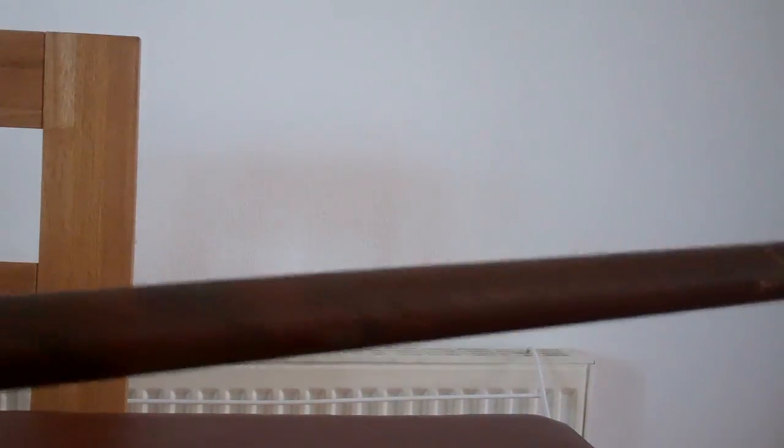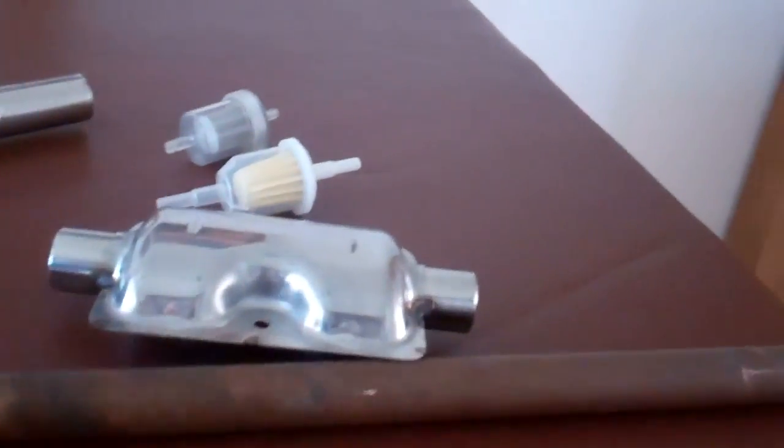And I don't recommend going overly long with this copper pipe, but you can more or less do what you want with it, and you can get your exhaust wherever you want it. Obviously, ideal place is opposite your sliding door, because you don't want to open your sliding door and your heater be pumping poisonous gases back into your van. So yeah, I've explained how crap these silencers are.